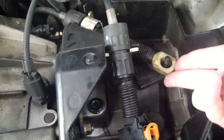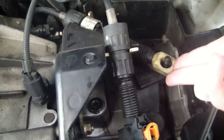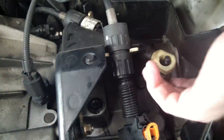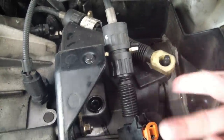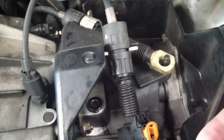What I'm going to do is build a collet assembly from parts from Pep Boys for less than $10. I've read cases of people having this problem and some have said the original part was made out of rubber. We just need some kind of rubber seal to keep this from jumping around, then put a clip on the end to keep it from popping off. The shifting should be tighter and more responsive, and I'll put a lot of grease on it to keep it from sticking.